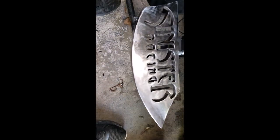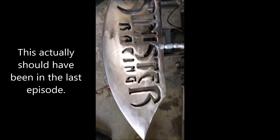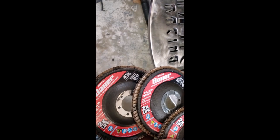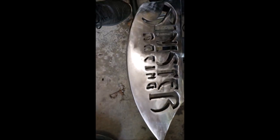Out here in the garage working on my floorboards. I'm going around getting off the mill scale because they're pretty black. I hit them first with a flap wheel — 40, then a 60, then an 80 — and got them looking halfway decent.